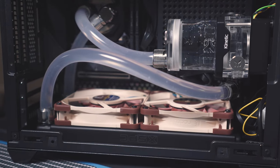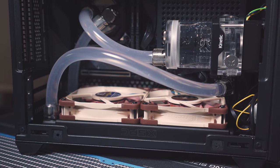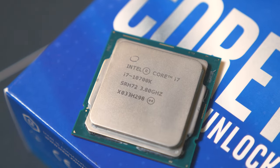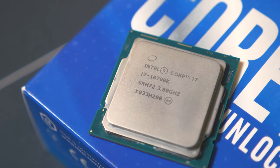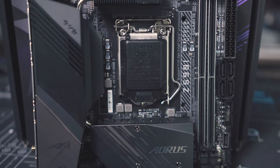I'm testing these rads in an actual built-up case, the Cooler Master NR200, 18 liters. I wanted to get an idea of the static pressure impact when the rad is actually used in a case, with the rads mounted at the bottom for easy setup. I just left the card out for the easy changeover between rads. I'm opting for the Intel i7-10700K at 5.0 GHz and 1.3 volts with the integrated graphics — just under 180 watts total package power — running on the Gigabyte Z590i Aorus board.